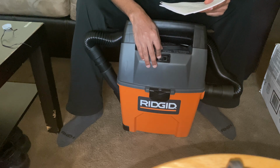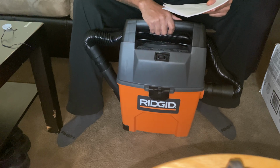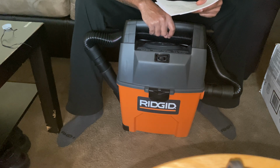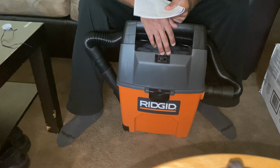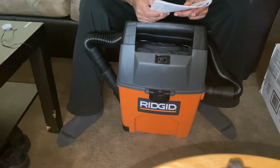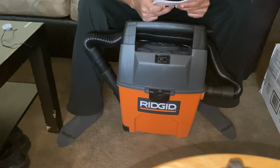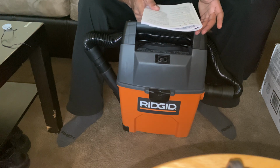To disinfect the drum, pour 1 gallon of water and 1 teaspoon of chlorine bleach into the drum. So that's easy, guys. Anybody can get 1 gallon of water. You get an empty milk jug and fill it up with hot water. Hot water temperature definitely helps clean it. Pour 1 gallon of water in. A teaspoon of bleach. And everybody's got spoons that you use to eat cereal with. That is a teaspoon.